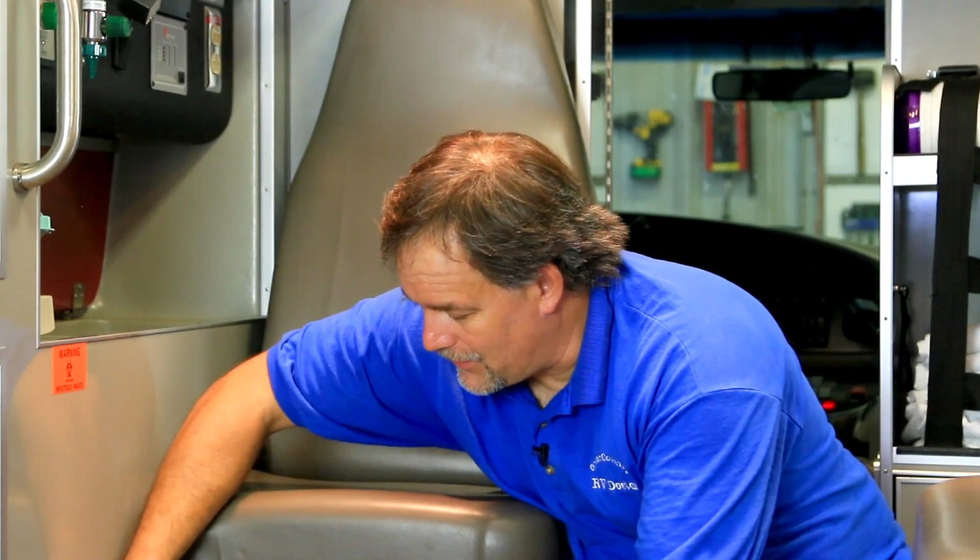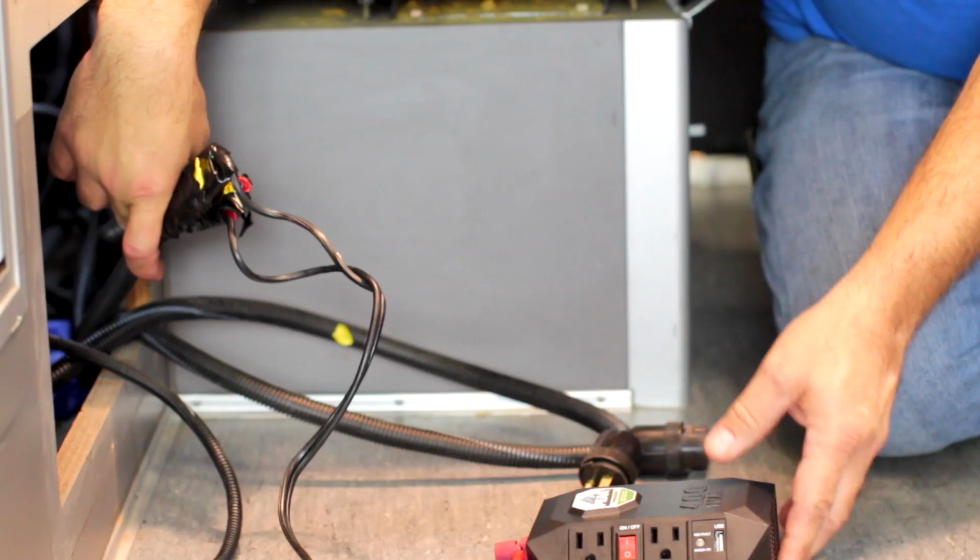So what we're going to do is we're going to go ahead and finish getting this inverter removed. Once that's done, I need to do a little prep on the leads. We'll get the new inverter set in, make our connections, go ahead and mount it, run a remote cable, and that'll give us the ability then at that point in time to go ahead and do a preliminary test on operation.